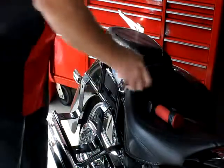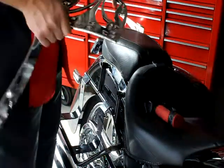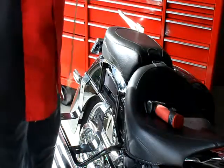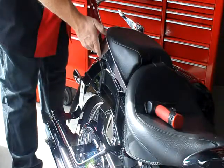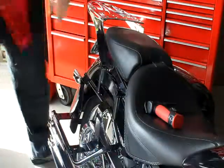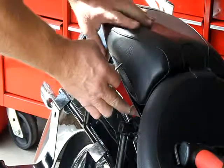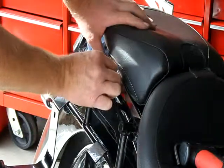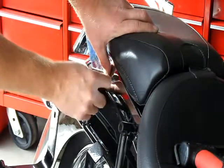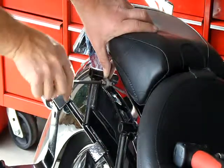Now that we have this fastened up and still in the loose stage, we're going to take the other side of our rack. I take mine apart into two pieces — the bag and bracket are a little loose on the other side with the rail inserted. Now we're going to insert it on this side, fit it up, and put it on. Next, take your locking feature — now that you've got your rail in place on the bike, insert your locking feature so it slides over the adapter, and get your 8mm locking bolt in there. You can see now why your half moon comes into play.